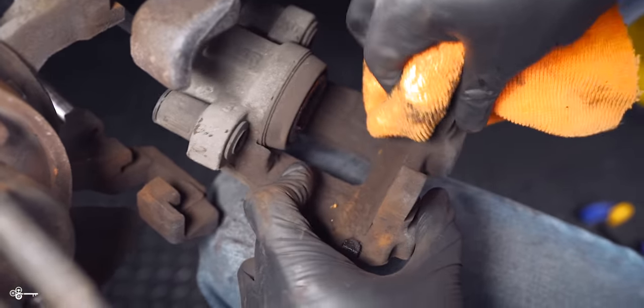Okay, now that we've changed the rear brakes, we need to tell the car that we did a brake job. So just press your start-stop button one time, go into accessory mode, wait a couple seconds for everything to just clear out. Then you're gonna press and hold this little button over here. It takes about 10 seconds or so to pop up. And this is the service menu. So we're just going to keep hitting it until we get to what we need. So here we are at rear brake pads. As you see, it said we had 28,000 miles left on the old one, but we didn't like the old ones. So we're gonna press and hold. And you let go and press and hold again. Reset is in progress. Okay, reset successful, and we are good to go.